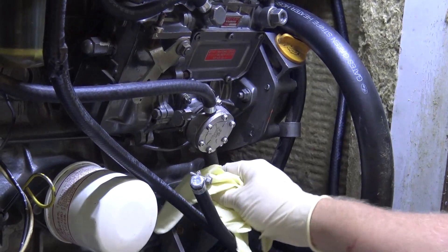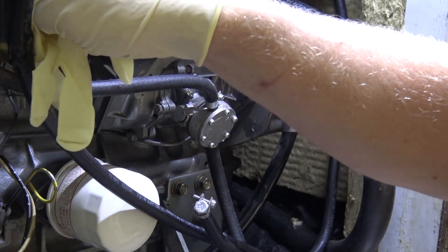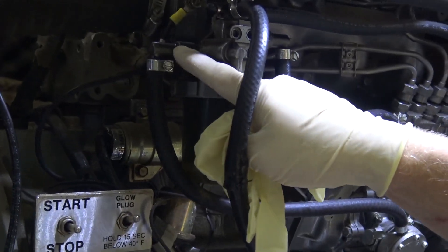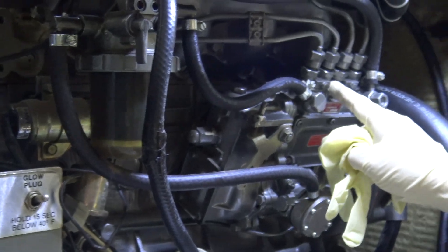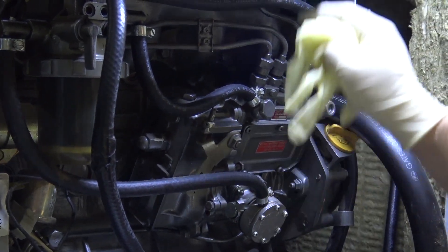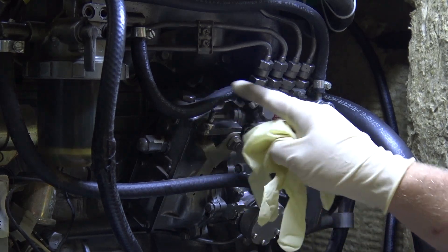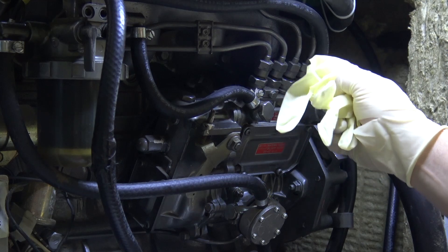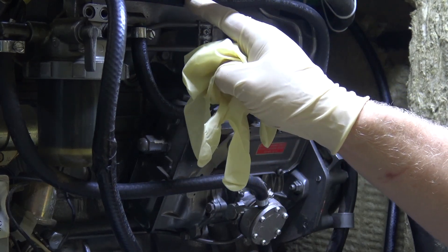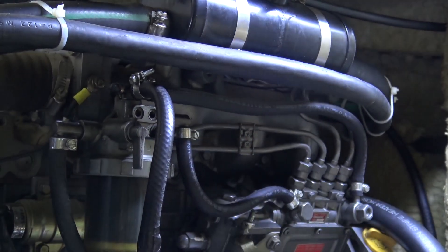What I'm going to do is take off this — this is our incoming line, comes in here into our fuel filter over here and then into the injectors up here. This is our fuel pump, so fuel comes in here and then from there it pushes it out, and the leftover spent fuel comes back through here along this line back into where the filter is.